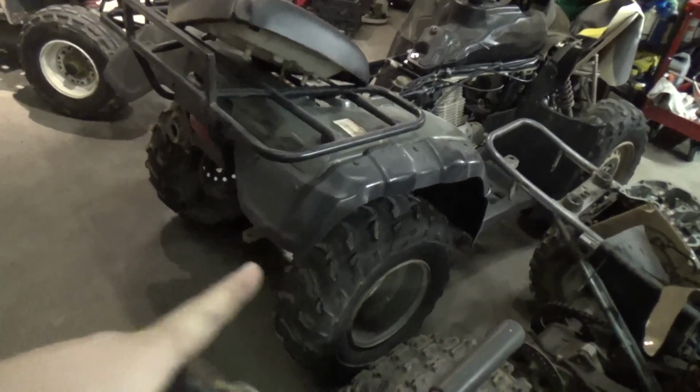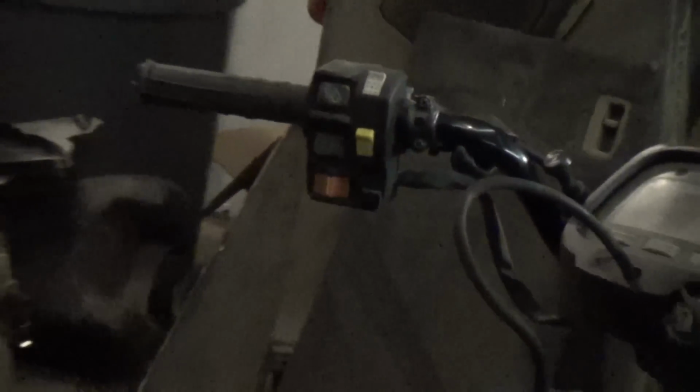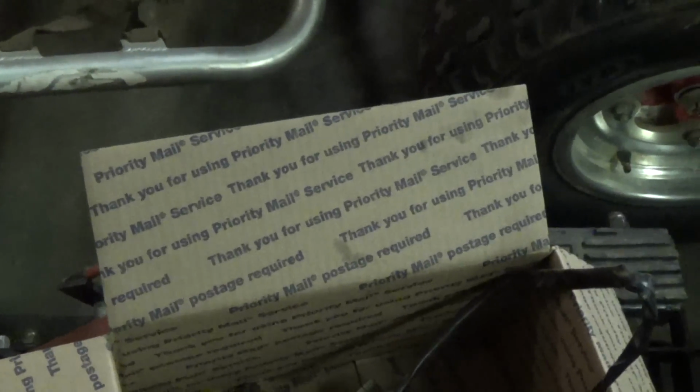First thing I did was I took the ECU. This ECU in this box is, actually I said it was from Elizabeth City, this is the one from this rancher. So the one that's on there underneath that, just above that back wheel, that's the one from Elizabeth City. Plug that in, didn't make a difference. Wouldn't shift. Alright, so then I took the controls. These are the controllers from my rancher. Took those off. The ones that are on there now are from Elizabeth City. Didn't make a difference. So then I went ahead and changed the angle sensor. Didn't make a difference. Then I went ahead and changed the starter motor. Didn't make a difference. So I changed basically everything you could change. I didn't change the gear select sensor, or anything with reverse at that point.